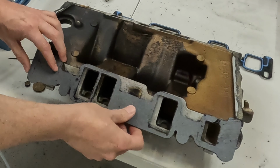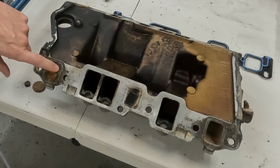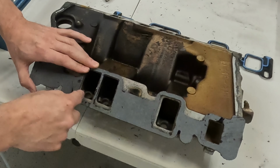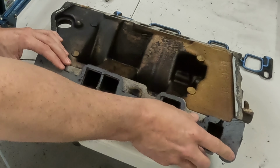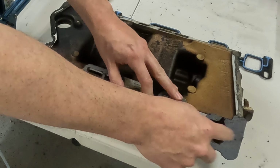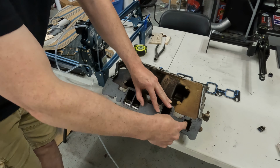As you can see on the back side here, we have blocked off the water jacket that does not exist on the V6 heads. The V8s would have a rear water jacket on it. These do not. On top of it, it is the same port size. I have not done the bolt holes yet. I want to get this thing on the heads and mark out the holes that way. But the ports are the same as the Vortec. And then the water port up here, I measured that and made it the size of the one that is actually the size of the jacket in the manifold.